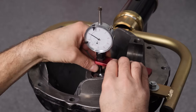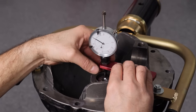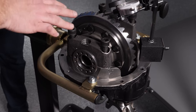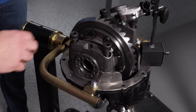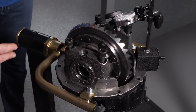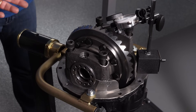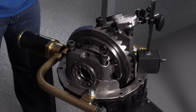We measured at one point four seven one. One of the things we didn't mention in the beginning is that you want to make sure you put the same caps back on the sides that you removed them from. An easy way to do this is take a punch and put a couple small dimples in each cap - ours were marked two on one side and one on the other so we had no chance of mixing them up. If you swap caps from side to side, who knows if there's going to be some little bit of difference between them, so it's better to just make sure you put them back where they came from.